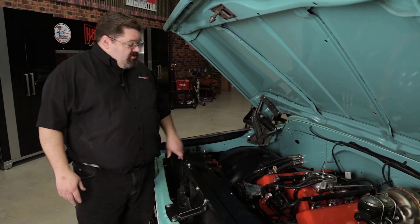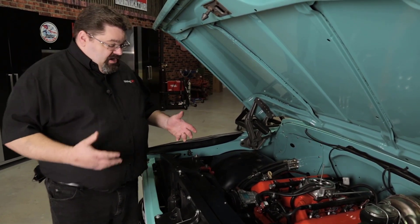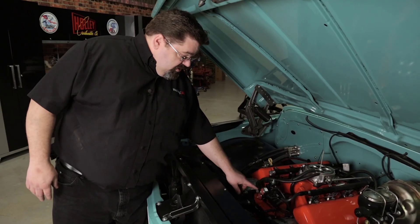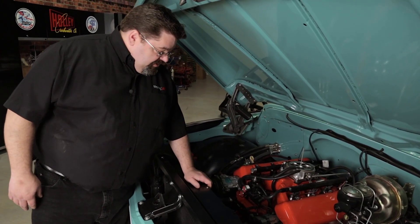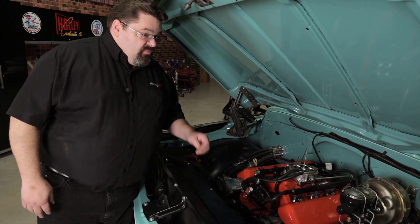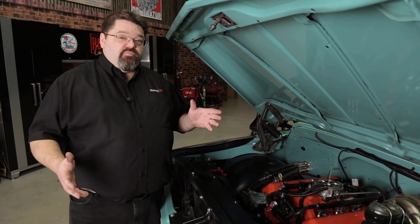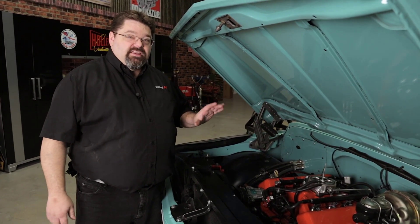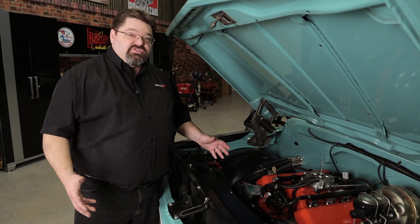We've marked off our check sheet on the undercarriage. Coming back up to the engine bay, some things you want to check are your line pressure as well as your return line pressure — something that's often overlooked. Our regulator has a gauge port, and I've temporarily installed a gauge into my return line. Ideally, your return line pressure should be zero. You really never want it to be more than four to five PSI. If you find you have high return line pressure, you need to figure out what's causing that restriction and rectify it before you proceed.